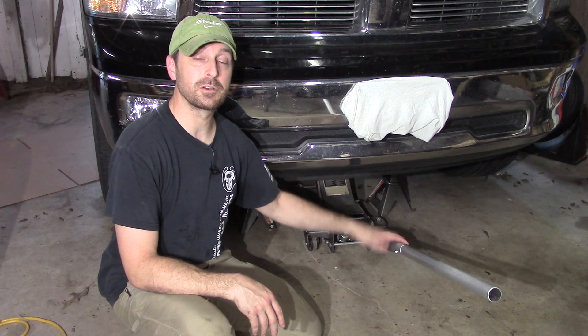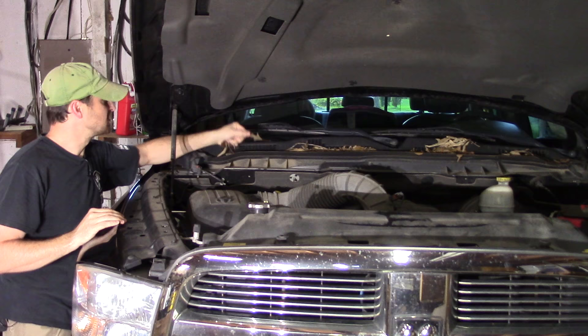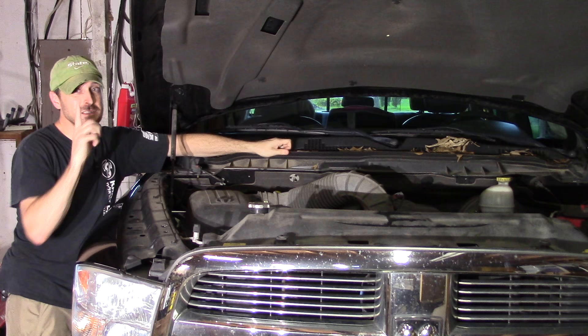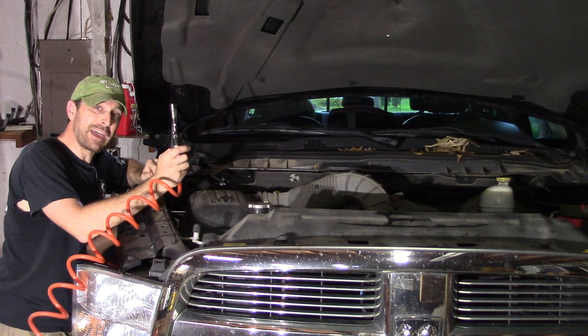If you have to jack up your vehicle to get to that drain plug, then of course use all the safety precautions necessary, including jack stands. Alright, let's have a look up here — you can see I've got a lot of debris, a lot of leaves up here, and we want to clean that out as best we can. Get all this garbage out of here so that the vehicle can breathe. That's number one. Number two, I'll take you down below and show you where that drain pipe or drain tube is for the air conditioning. What we're gonna do is just take a little bit of air from an air compressor and blow it up in there.